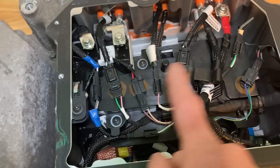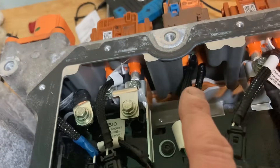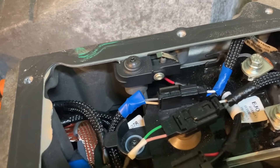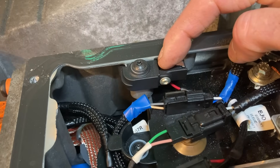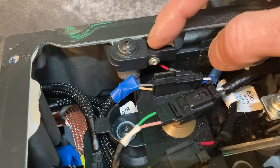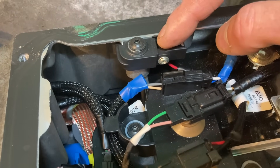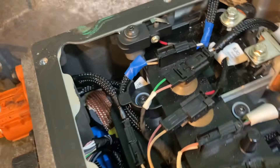The plug bridges these two wires and this is fed back into the ECU — effectively the top half of the rectifier which is like the ECU for this box — and it tells it whether it's connected or not. So all of these little two-wire connectors are safety interlocks. There's also an interlock for the lid — when the lid's on it bridges the connection, it pushes the switch down. So if someone were to take the lid off not realising the high voltage system was on — because the Zoe starts the high voltage system as soon as you open the door — when you take the lid off it opens that switch and the car shuts the high voltage system down.